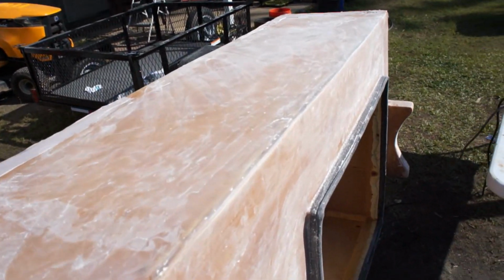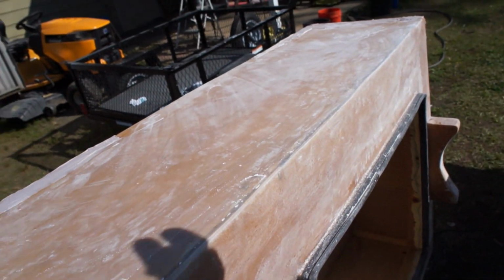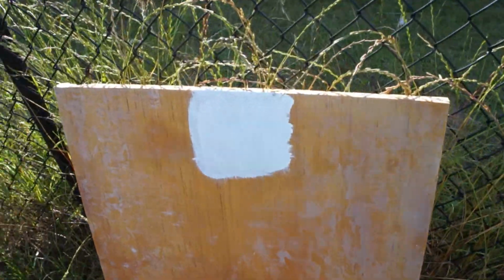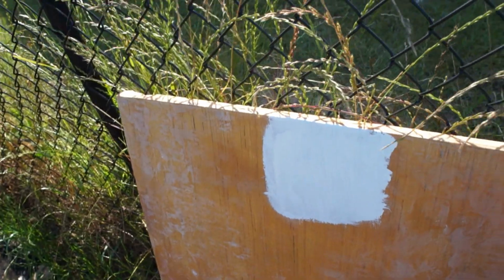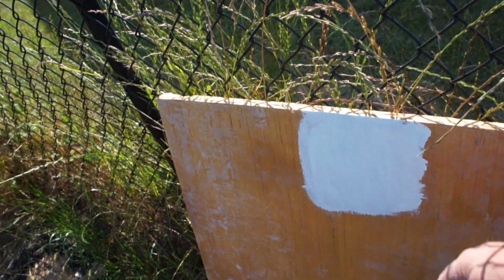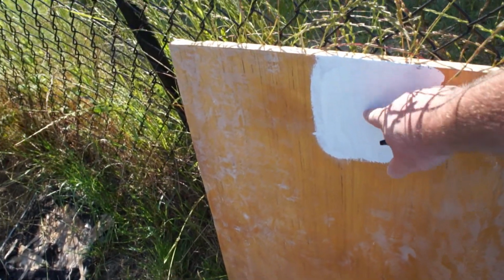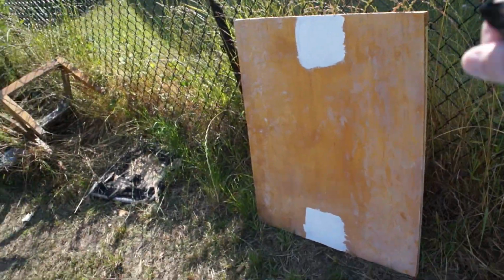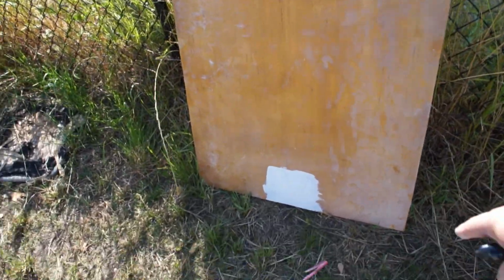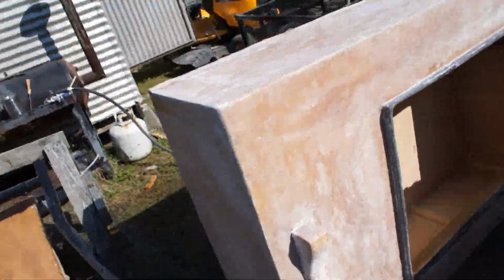You know, they're really small, like these. Sanding in the middle of those, throwing Bondo on there, and then smoothing it out. Similar situation here that I did. You can't tell, but this is where the latches were, and I basically sanded that down. Obviously there were some air pockets in there. Then I went back, sanded on the inside of it, and then filled it with Bondo, sanded it back, primed it. And so that one right there, I need to finish sanding in the middle. I got a lot of the edges done, but you can still see the waxing areas in the middle. That'll have to be sorted out. But anyway, that's where we're at.